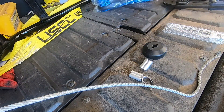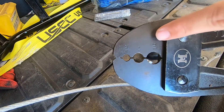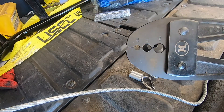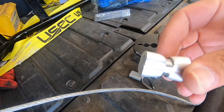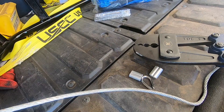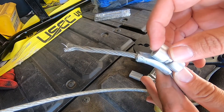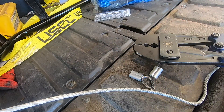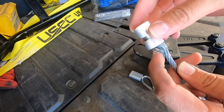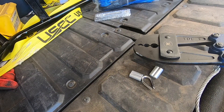I've moved the Honda into the shade so you can see better. These crimping sleeves come in different sizes for different size wires — I'm gonna use the quarter-inch one. When you crimp it, this is what it's gonna look like. I want to do three crimps per sleeve. The stock one on here is a little bit longer than this one, so I'm actually gonna put two sleeves on — overkill for one reason, and also because when I cut this with my bolt cutters it's a little frayed, so I want to cover that frayed end up.